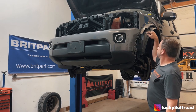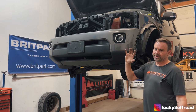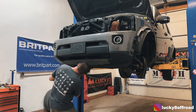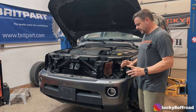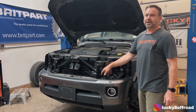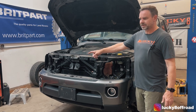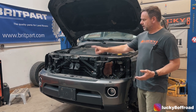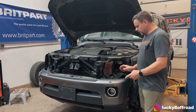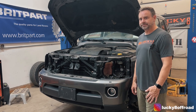Next up, we're going to want to get the bumper cover off. There are some T30 Torx screws on the side and on the bottom — I said T27 but they're T30 on this car. With all the Torx loose on the sides and bottom, you have to pull out the bolts on the top of the bumper — on this LR4 they are 8mm. Get the Torx off the side, the bolts off the top, then gently wiggle the bumper forward. There's a wiring harness on the right hand side to disconnect, and you'll also have to deal with the washer bottle squirts. If you have a friend, this is when you want them to help.